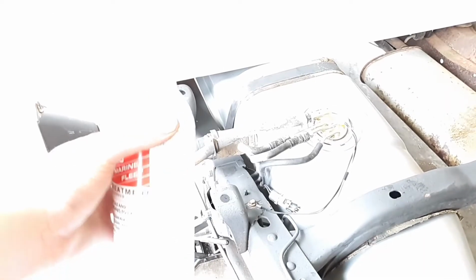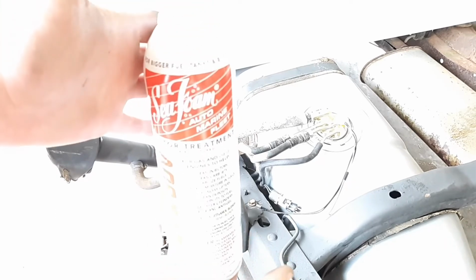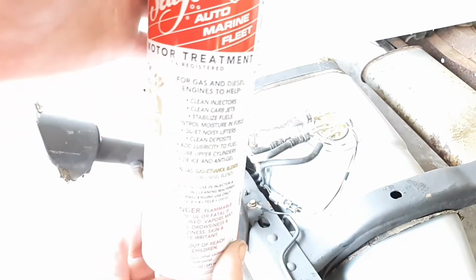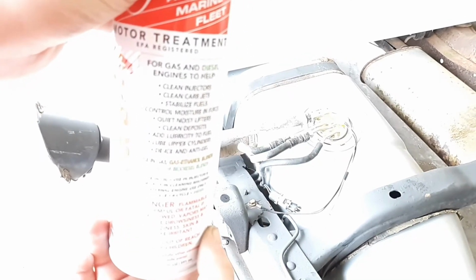Not a sponsor, but I'm going to go ahead and dump in a 20 fluid ounce can of Seafoam to clean the complete fuel system, like the injectors and everything else, because like I said, that old fuel and junk got all the way sent to the throttle body. So I guess we'll see what happens.